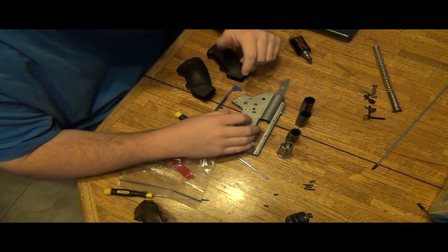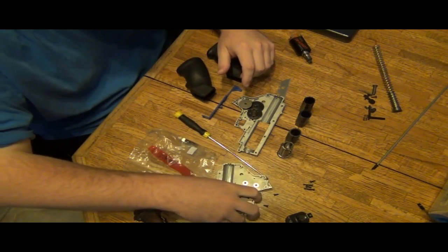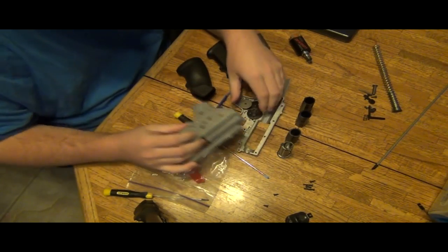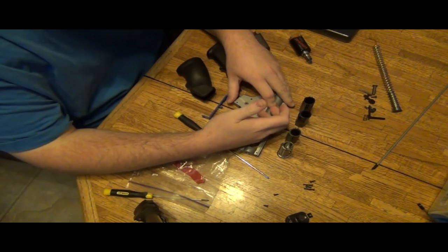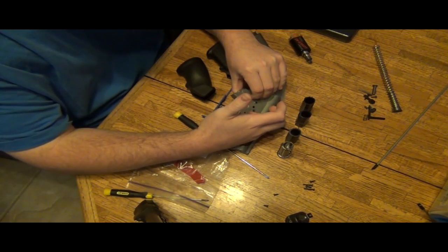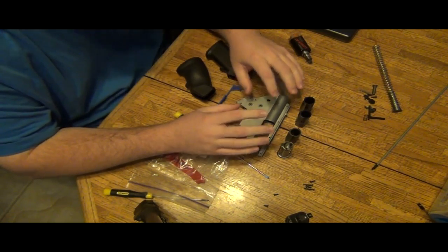Now, one of my questions that I had on a questionnaire was, if you're shimming with 0.1 millimeter shims, how much looseness should there be for the gears in the gearbox? So in here we've got this sector gear that, if I was to tighten this gearbox with screws, cannot move up or down. So this gearbox actually takes the special type of shimming that I'm talking about.